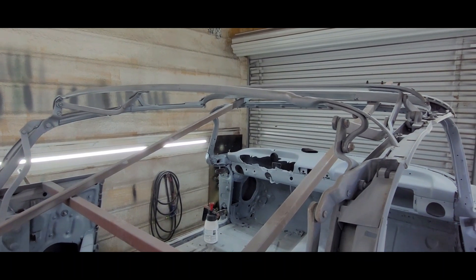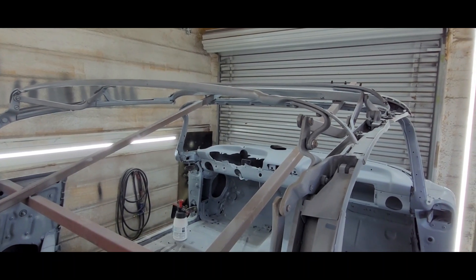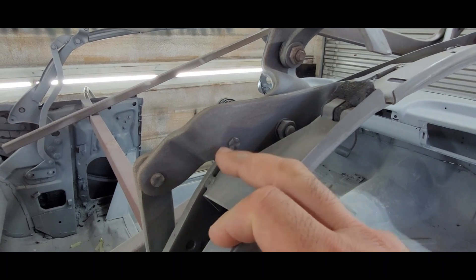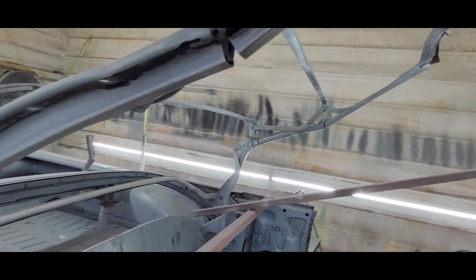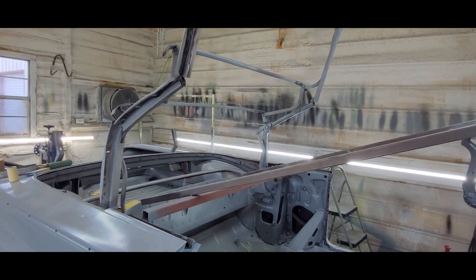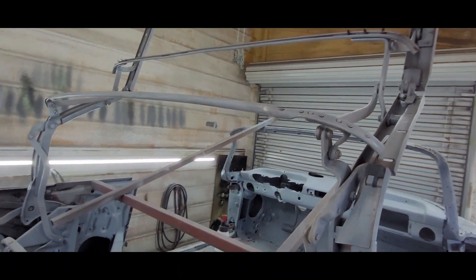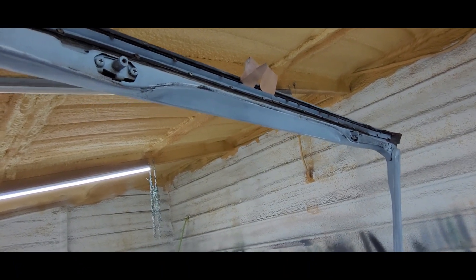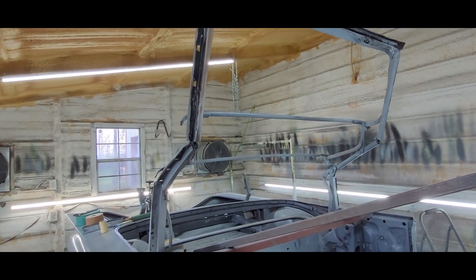Rather than take the rack out and chrome it — which I don't care about — or powder coat it, I wouldn't powder coat it together because all these rivets are going to get locked up, just like some hood hinges do, and it's a big mess. Right now this thing moves pretty freely with one hand, and I like that. So I don't want to go down a rabbit hole. Anyway, what I did this evening was just prepped it — basically scuffed it up, got it completely gutted, all the tack strip is gone, any of that old sealant is gone, and any heavy scaling is gone. We're ready to roll.